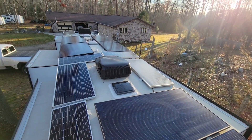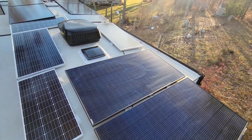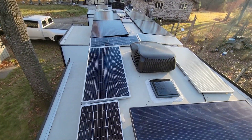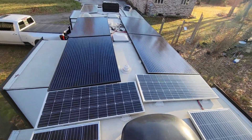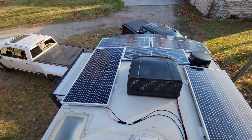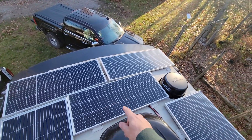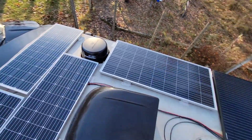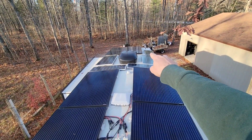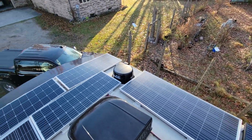We're up on the roof now. As you can see, the roof is pretty full — there is no room for any more watts up here. This is the max you're going to get on this 39-foot fifth wheel. Working from the front to the back: there's a bunch of 100-watt flex solar panels filling in the smaller areas — six of them total. Three here and two right there and one at the back. Three are in series, three are in series, and then they come together in parallel.